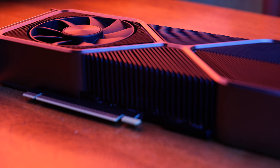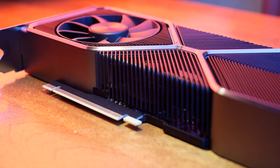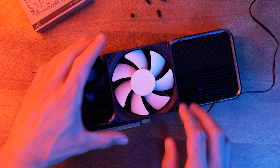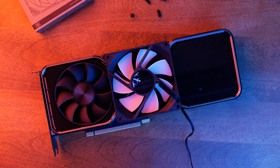However, as I was planning this out, I thought about the natural flow of air in the actual card — mainly the air moved by the push fan on the bottom. If you look closely, there are metal openings in the silver metal portion that allow air from that fan to flow out and across those center fins. So my thought is that this added fan may be fighting against that flow from the rear. To follow the theory, I will do a third test with the fan in a pull configuration to see what the differences are. Though this may also fight against the pull fan on the other side of the card — but there's only one way to find out.